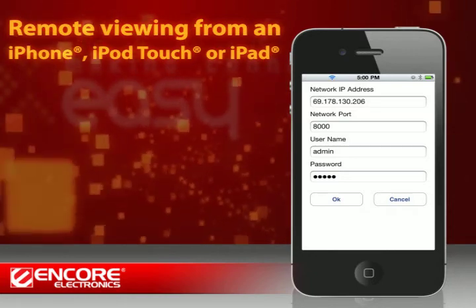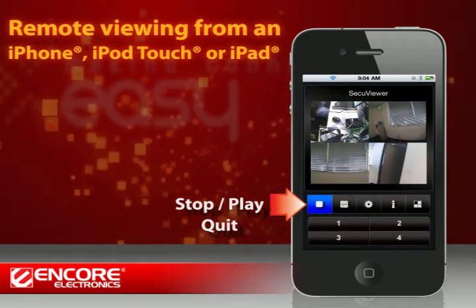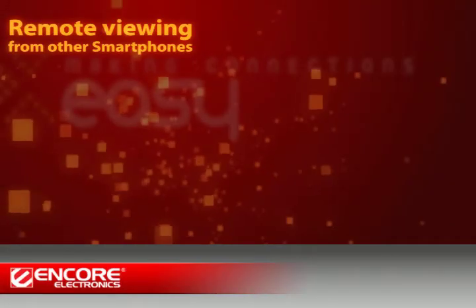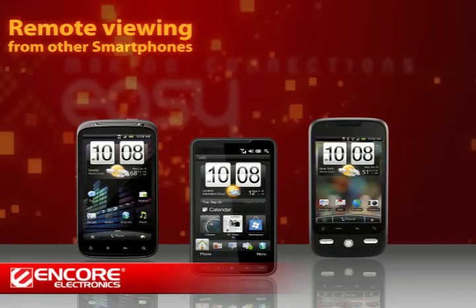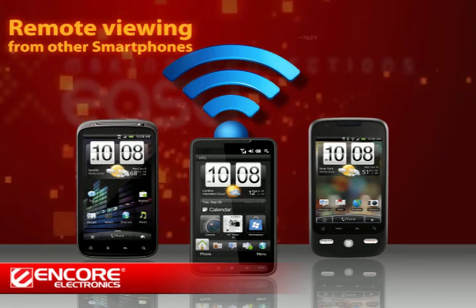On the Configuration screen, enter the IP address, port number, user name, and password of the remote surveillance DVR. Use the Stop or Quit button on the left to stop streaming from the remote surveillance system. With other types of smartphones with Internet capability, you can type in the assigned IP address to your phone's web browser and watch real-time footage remotely.